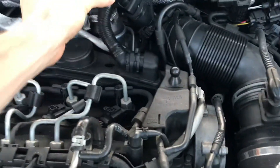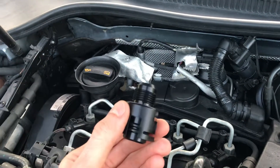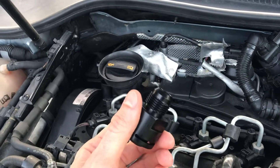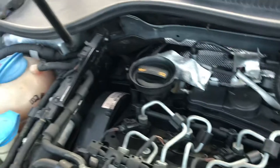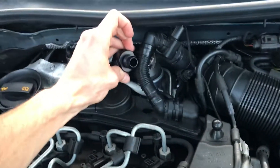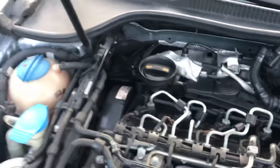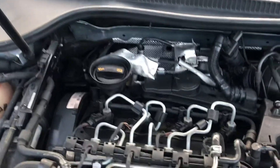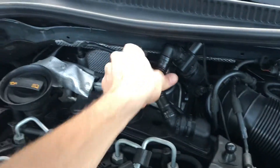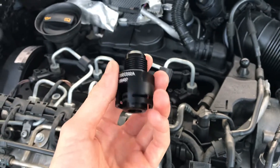These two will have dash-12, these are dash-10 size, but BMRS makes some beautiful lines and fittings — one of which adapts from 10 to 12 as a hose end, which is really cool. If you look at the size of this versus that, dash-12 is what you need. BMRS also has the Teflon corrugated tube, so it'll be good for vacuum, and I think these fittings are going to work out excellently. I'll do some videos of the install.